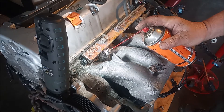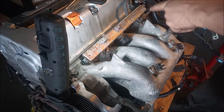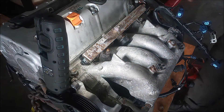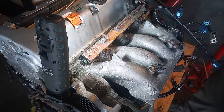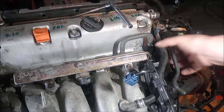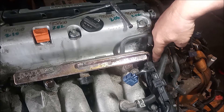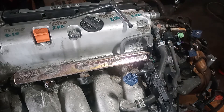We're going to spray these with a little bit of penetrating oil. But before we try to remove these nuts, we're going to disconnect the fuel rail from the fuel feed hose, which is on this side over here. The fuel feed hose connects to the rail with a quick disconnect — these two green tabs have to be squeezed together, then you can pull the fitting back.